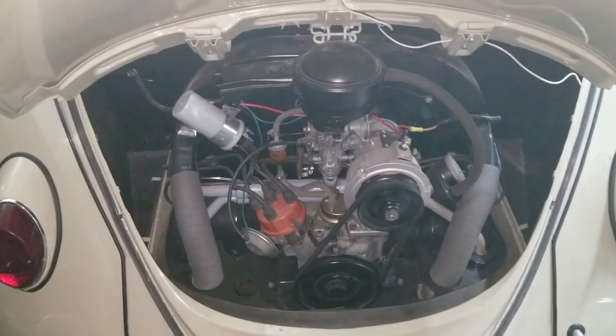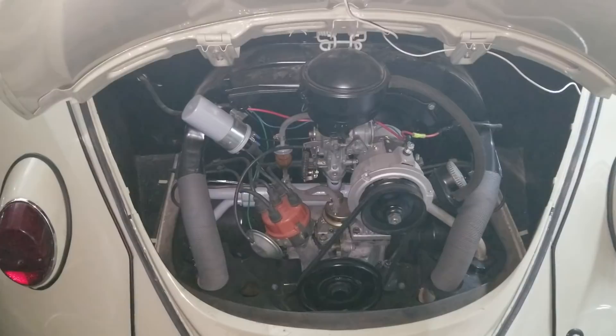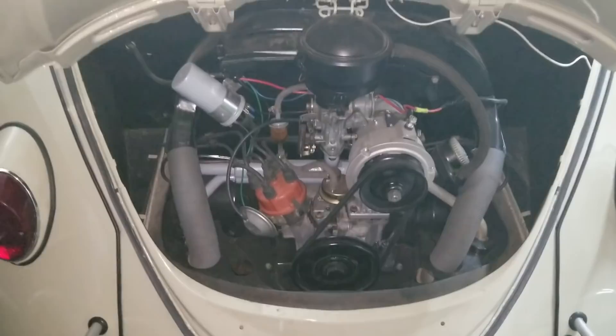First of all, I want to tell you guys that when you power up your 40 horse, you really do have a limit, because the 40 horse crankshaft will tell you that when it cracks. If you do too much to one of these, the reason why a lot of guys aren't doing huge mods to their 40 horses is because the crankshafts just aren't that strong.